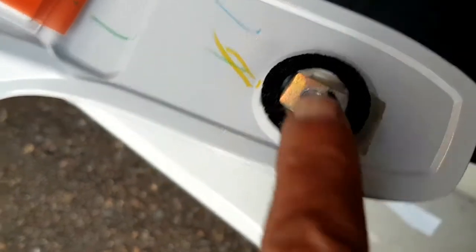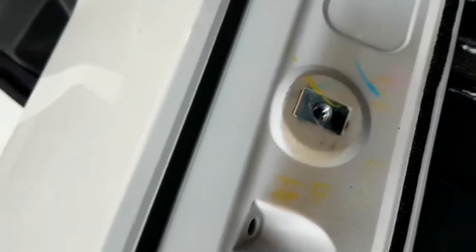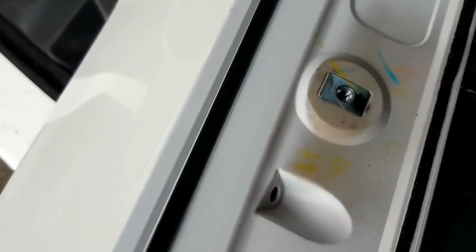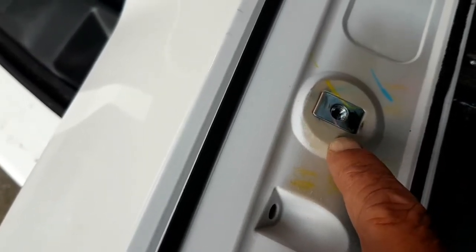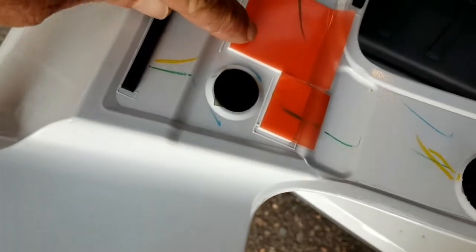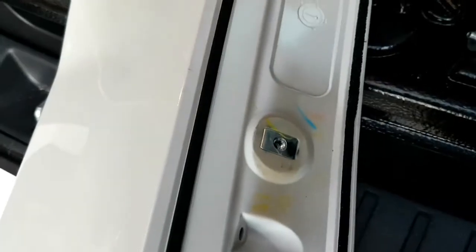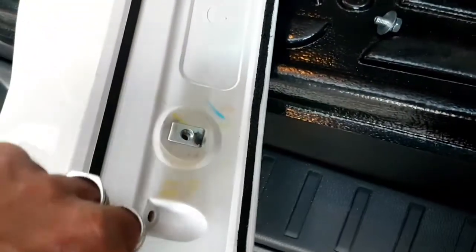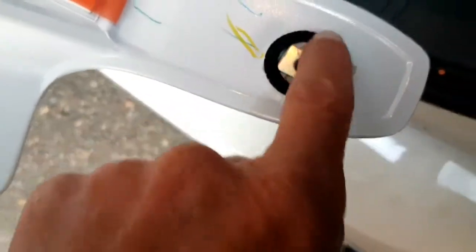Here's the actual spoiler. That's where the bolt goes in, and there's a rim around the outside — a ring, like a piece of foam that probably protects it from water, but I'm going to put a small coat of silicon around here. These other points don't have a round seal, so I'm going to silicon around them a little bit so it just presses against it. Silicon will be pretty easy to get off the car in the future if it's ever removed. There are pull tabs to remove these pieces of plastic, and there's a double-sided tape seal which sticks onto the roof as well. I can't see why water won't get in here and work its way into that hole, so I want to seal around that and put a bit of silicon there too.